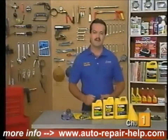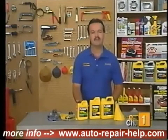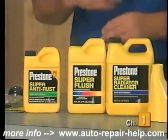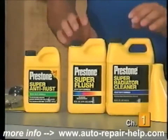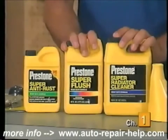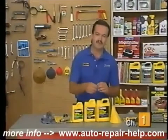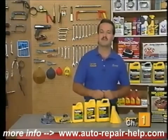One of the things I like to use periodically is some anti-rust. I put some of that in about once every year — it just helps replenish some of the corrosion inhibitors in your antifreeze. Now if you're going to be flushing the system, I suggest getting a radiator flush like this, or if the system is really dirty, get a heavy-duty radiator cleaner similar to this one here, because that'll help get the rust and corrosion out so when you replenish the antifreeze you've got a clean system again.